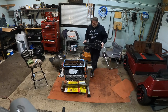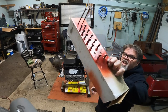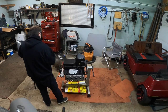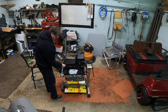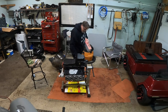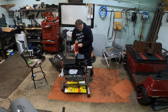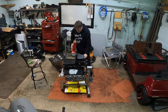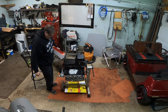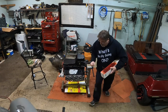So now we put the pan back on and we can get some bolts. I painted all my bolts — look at them things, they look amazing. I'm going to take the front ones too, because once I get my balancer I can take those two bolts out if I have to move it a little bit. I want the gasket to set properly, so we're going to do it that way and then I know I'm safe. I hate to say it again but I'm missing a bolt — I think I dropped one. There it is right there, I did drop one.